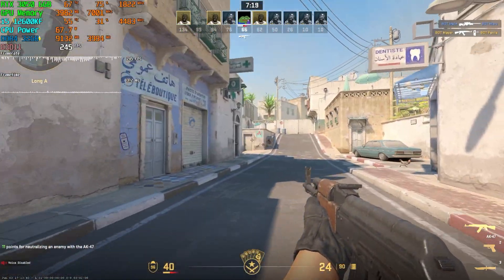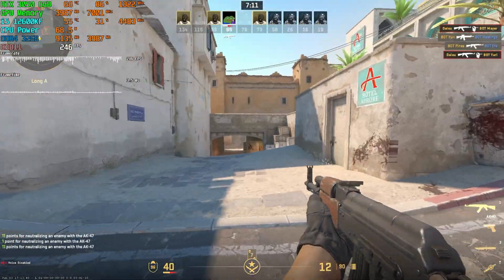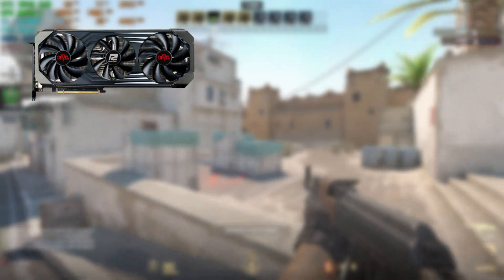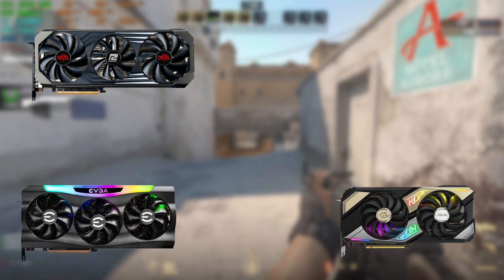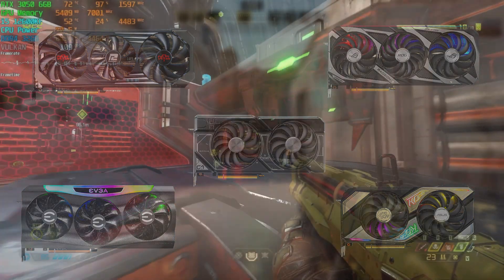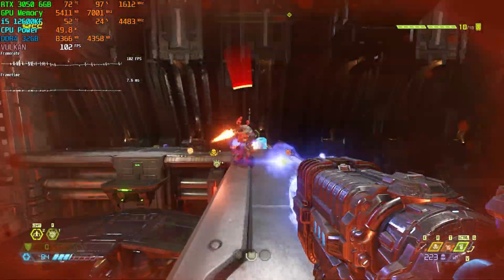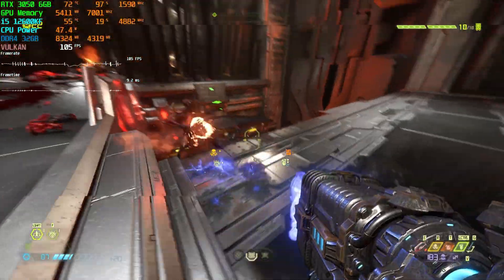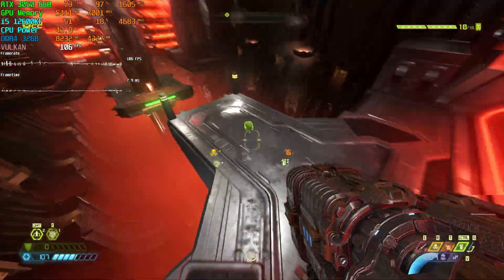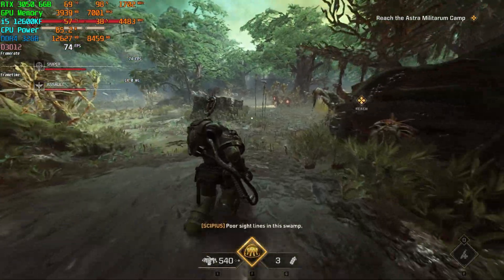I did still limit the CPU to 120 watts, because in gaming you really won't notice much difference since games use around 60 to 90 watts on this CPU. The GPU people would normally pair with this CPU is something like an RX 6700 XT, RTX 3070, RTX 3080, RTX 4070, or an RX 6800 XT for AMD fans. All of these GPUs will never make this CPU draw more than 100 watts, except briefly when loading into a game. I was monitoring wattage across Warhammer 40K Space Marine 2, Witcher 3, and various other games, and I never saw the CPU go over 120 watts.